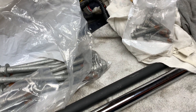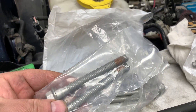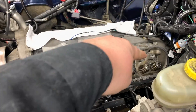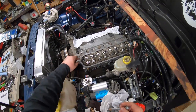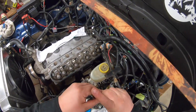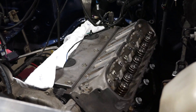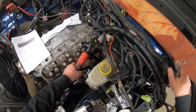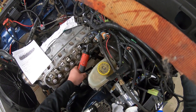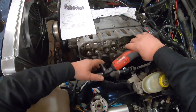Depending on what kind of LS Vortec motor you've got, you may have all this length of bolts. The earlier versions had these two shorter ones which go on the upper holes. I'm going to start feeding all of these in by hand — doing it by hand is going to take forever. So I spin them in with the ratchet on super low torque like that — helps speed up the process.